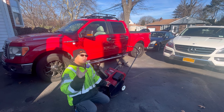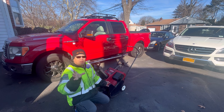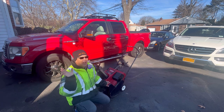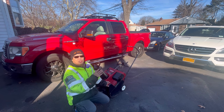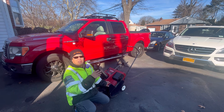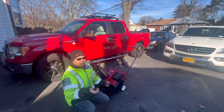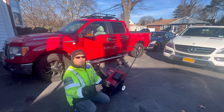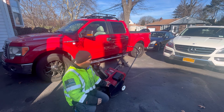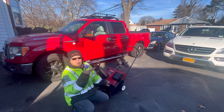So there's another way you could subside the smoke. If you have a two-stroke engine that smokes a lot, like a fog machine, usually there's a spark arrestor near your exhaust, either behind your muffler or something like that, and it's like a mesh thing that builds up carbon from all the use over the years. You could take a torch and burn all that off, or just brush it off with a wire brush, and that ought to fix it. That's just the fuel air mixture is what it is.